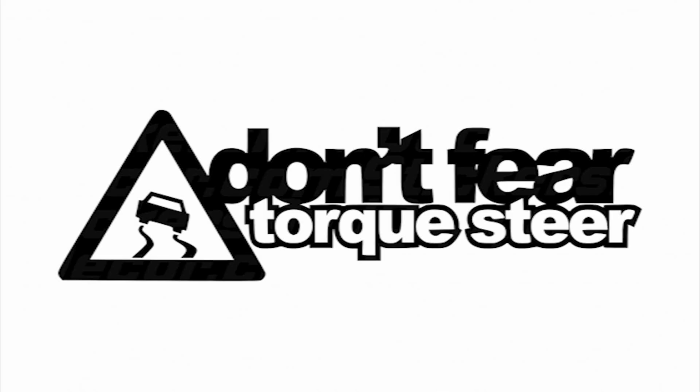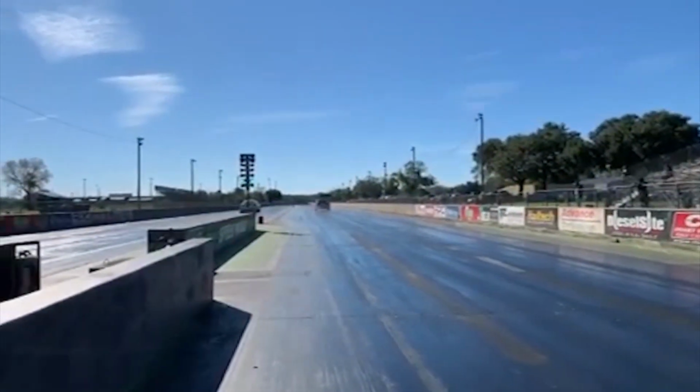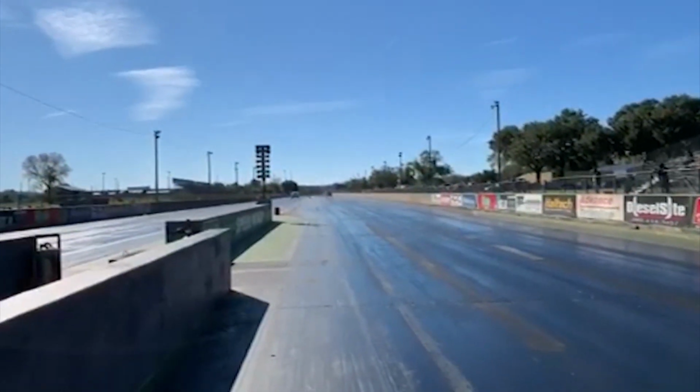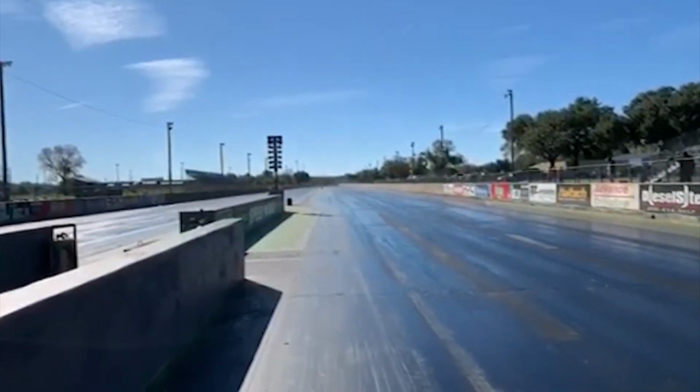And to add, keep in mind with abnormal tire wear, you may also run into torque steering. This is a completely different topic, but in short, it's when a vehicle tends to pull over to one side during acceleration or braking. The same applies to acceleration, and your car will naturally fight for traction as you go heavy on the throttle. And the larger your contact patch, the faster your car will get the traction it needs.